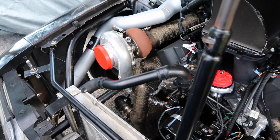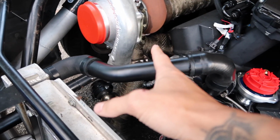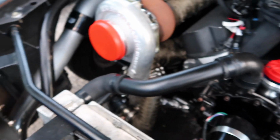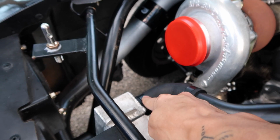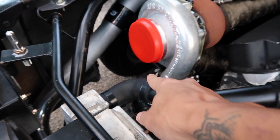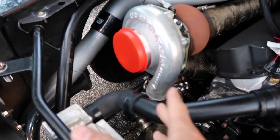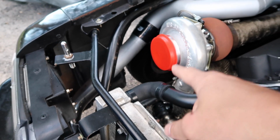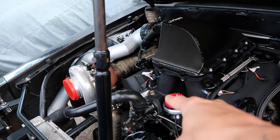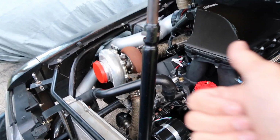So I ended up sanding down the radiator pipe, repainting it, and it actually turned out pretty good. And if you guys remember, I had to cut this hose here to get it off because everything was stuck. So I went to Advance, picked up a new little section of radiator hose, cut that out to a 90 to fit our purpose, got that into place, and the radiator hose was good to go. And then I put our new thermostat and thermostat housing in, got all that buttoned up. So that's good to go, it's all tight.